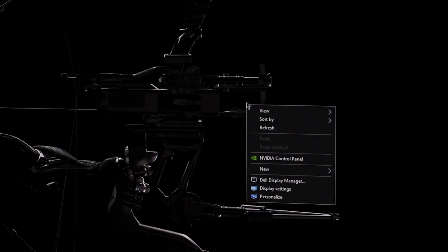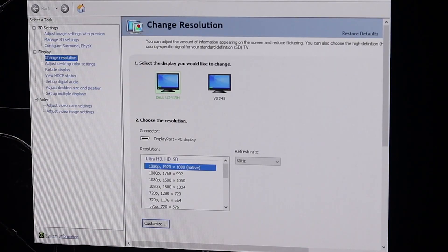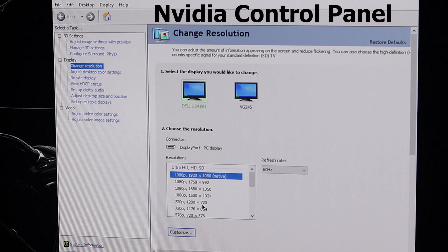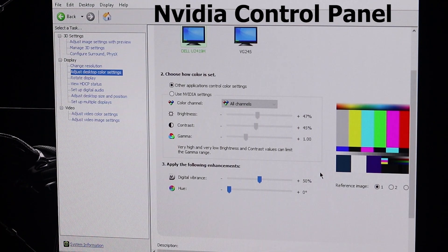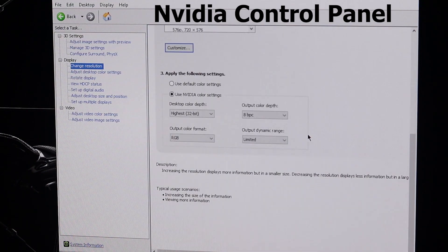There is a specific feature for this. If you are watching this video, you'll need to go to the NVIDIA control panel — sorry to AMD users, this applies to NVIDIA GPU cases. In the NVIDIA control panel, go to 'Change Resolution' and 'Adjust Desktop Color Settings'. In the settings, as long as you have an NVIDIA GPU, we can see the output dynamic range option along with brightness, contrast, and gamma.